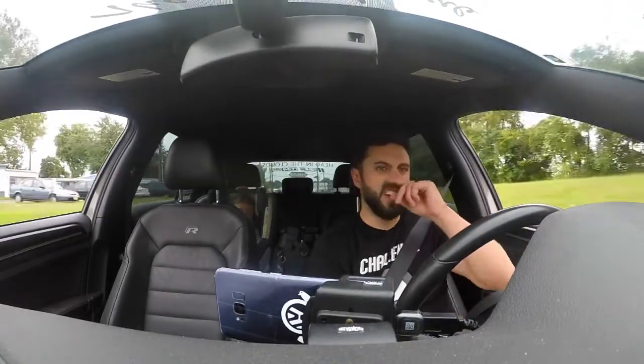Underneath the boost by gear, I don't think that applies to us with the Golf R platform. For the do-it-yourselfer guys, I talked with George about the fuel bias. The fuel bias is the AFR bias, so you're changing your fuel trims essentially.